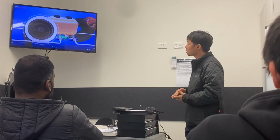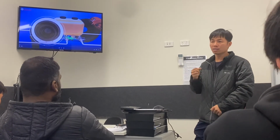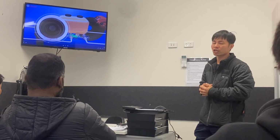Sometimes it's because fluid is suddenly leaking bit by bit, and just air coming in. It could be, but less chance. Then check the whole car and inspect the rubber parts, because it normally happens on rubber parts or the wheel cylinder. The wheel cylinder is used for the brake drum. So if you only inspect that one, you need to take off the whole brake drum. Or sometimes if it's leaking too much, you can even see from the side that it's wet with oil. That is how we do the visual check.